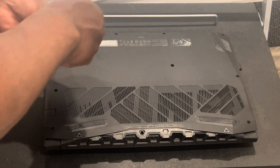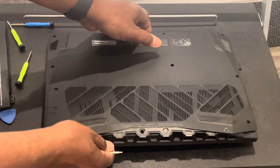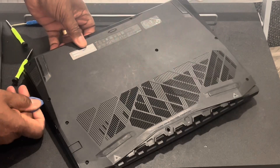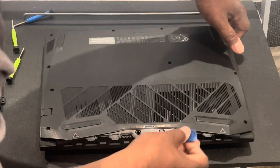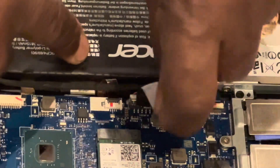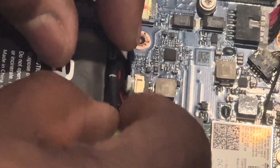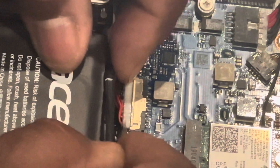I'm going to take the other 10 screws out — a total of 11 screws to take this back cover off. Then you take that little spudger and run it around the edge, and make sure you don't have any static electricity. Try not to touch anything you don't need to touch. As you can see, there was a little tape on the battery to hold that connector line in. You take this connector loose — make sure you remember which way it comes out.